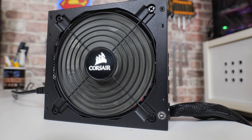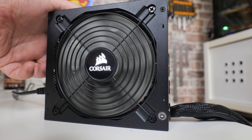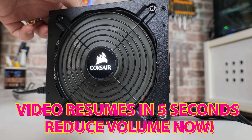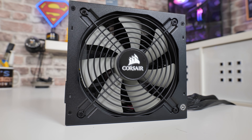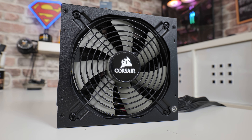You've also got a 140mm fan on top, designed to be thermostatically controlled. It isn't a zero-dB eco fan — it doesn't turn off entirely under low loads, it spins continually. I actually prefer that, especially on a low-noise unit like this one. Let's give you some footage I took earlier of this fan in operation at idle mode so you can hear how quiet it actually is. As you can probably tell, you can't really hear it at all — extremely quiet. It's a fluid dynamic bearing fan, which makes it a little bit quieter than sleeve bearings.